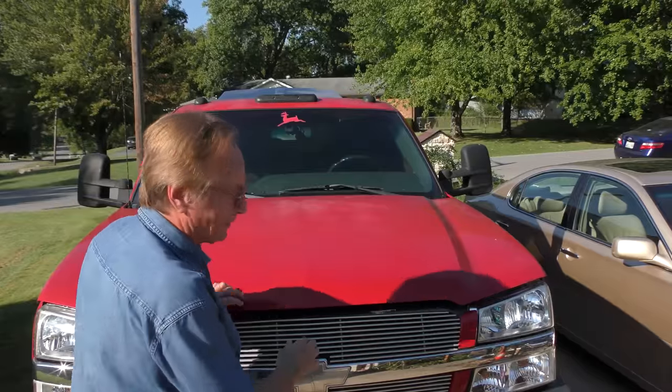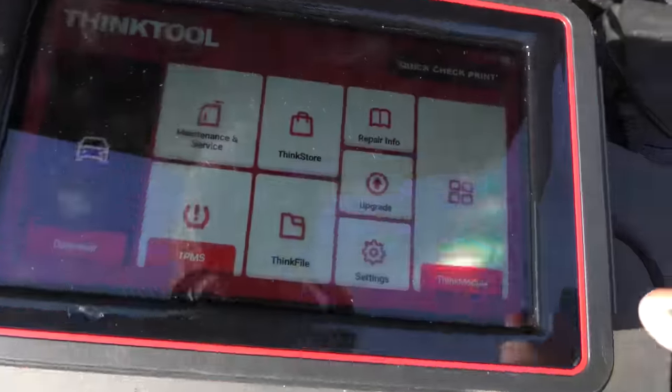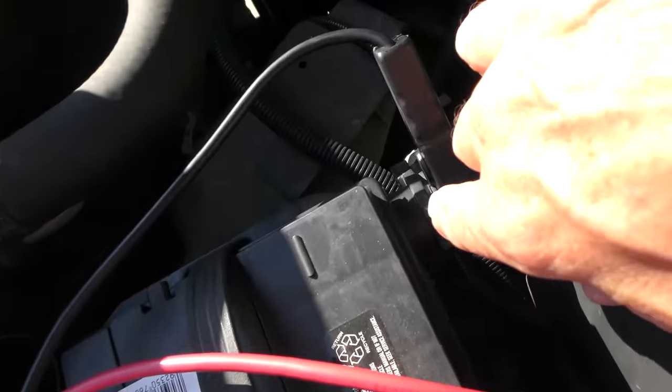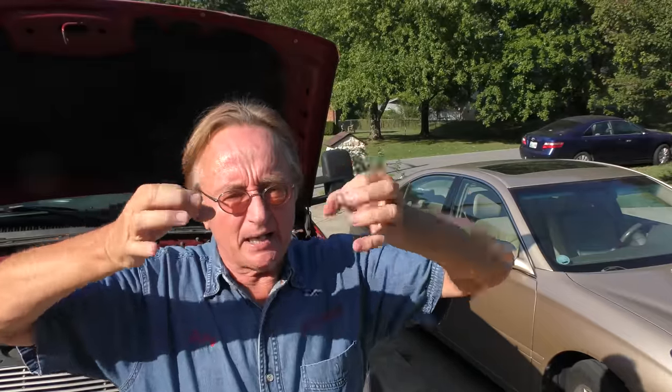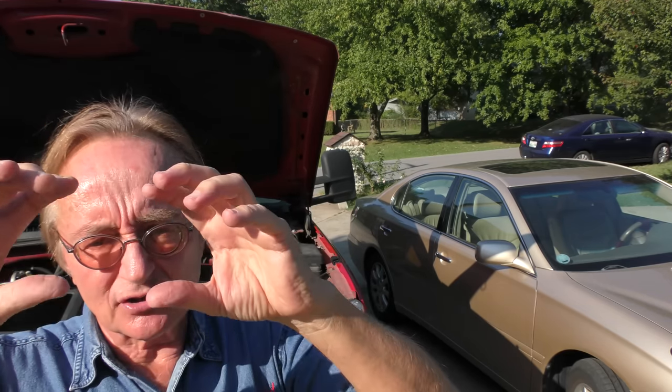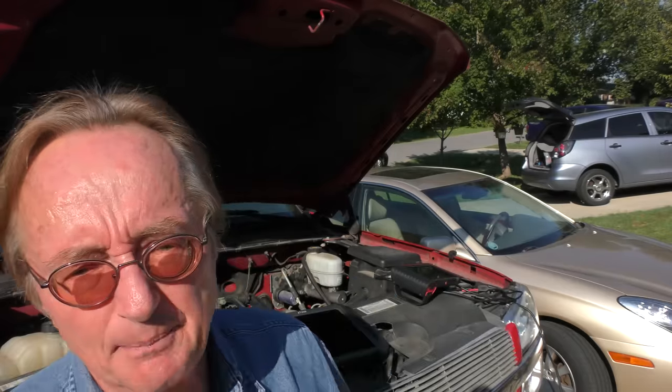Any time you've got an electrical problem, first check the battery. You can see people have been messing with the fuses. Now, I'm going to show you something that adds to the insanity of GM — they came up with these stupid side-post batteries. Instead of having nice big battery terminals coming off the battery with big male parts and big cables clamping on them, they've got these stupid little side terminals that screw into the side with a much smaller contact area. With less contact area on these stupid side terminals, any looseness or corrosion will impact the electrical system massively. I've fixed many of these merely by taking the terminals off, replacing them if corroded, or cleaning them up and getting them on super tight. But we're going to check the battery first.